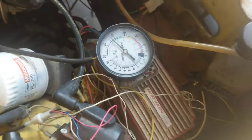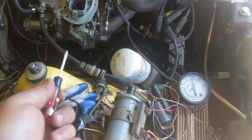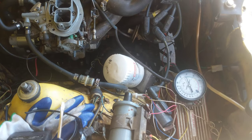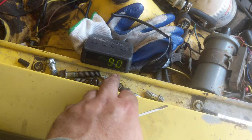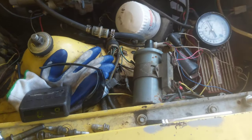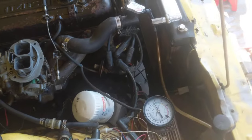There you go. So I adjust it for maximum vacuum — I went to the lean side, screwed it in, and when I got to the rough idling I went back out. You don't need the vacuum gauge to do it because you can hear the engine struggling. Right now it's about 900 RPM, because that's the idle setting for this engine. Could be less, could be more — it depends. On this car there's a spec that says it should idle at 900, but you can do 750 if you want.